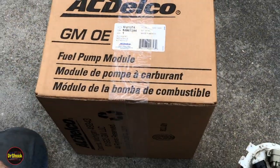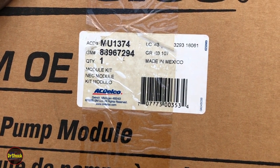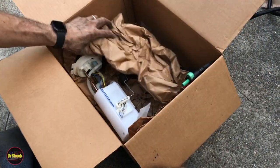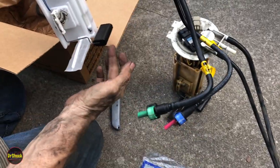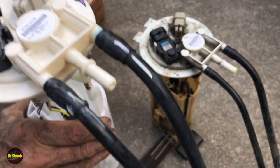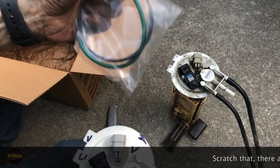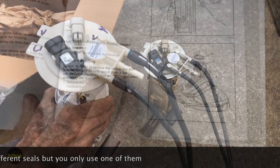That's the unit we believe failed. With a safe light, check inside the tank for rocks or debris — this one looks pristine, with the expected gray sealant coating. The replacement lock ring is an ACDelco TR7 or GM 25691383. The replacement fuel unit is an ACDelco MU1374 or GM 88967294. This unit is basically identical to what we removed — two brand new lines, new sock, new level sensor, and a new pressure sensor already included, plus two new O-rings.